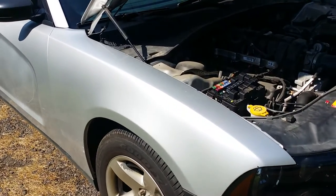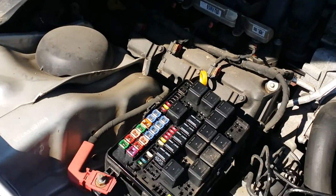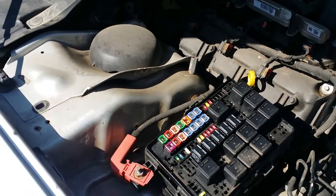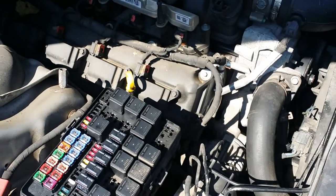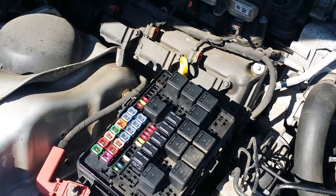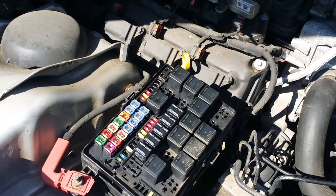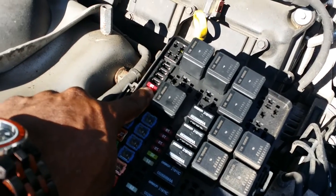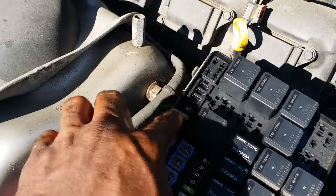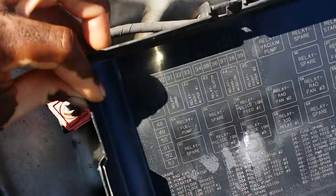My 2013 Dodge Charger's AC unit stopped working. So I was in line at AutoZone, and I looked on the internet to see how much AC condensers were at other places. They were like $250 at the cheapest online place. Then I seen a post on one of the forums that said you can check fuse #12, which is a 10-amp that goes to your AC clutch. They said it's a popular problem with these Dodge Chargers.